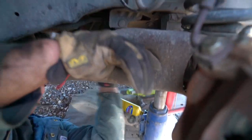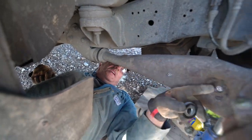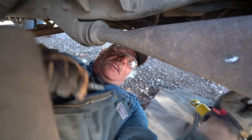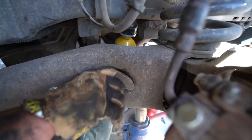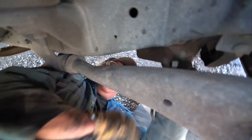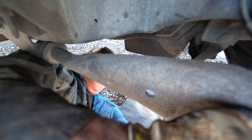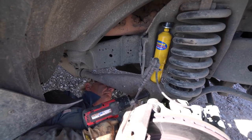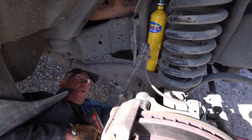So what we did was it cut the stud off — the weld — and the stud came off. That's welded on from the factory. So instead of getting panicky and going through withdrawal symptoms, you just drill it out. And it takes a 5/8 bolt, which you take out of my trailer hitch and put in there. Exactly. So we put the shock up there. This side you don't have to fight like the other side because we already got the thing off. Then we put the washers on — spaced it up with some washers — and we put a self-locking nut on it. There you go. Done like supper. Good as gold. It'll never come out of there.